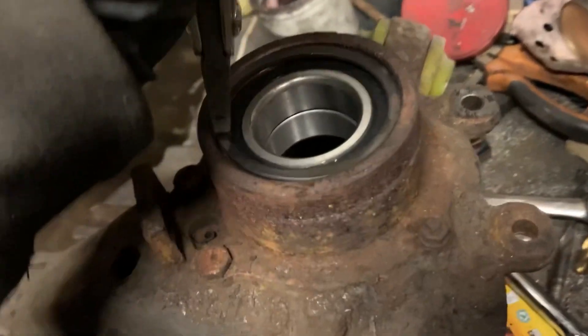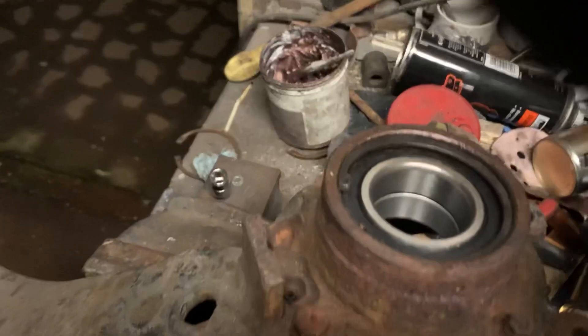Now that's in, we're going to put the circlip in one-handed and see how that goes - almost, look at that - and that is done. Next thing I'm going to do is drill the holes in the disc to match the hub to the 5x114.3 pattern. It's half ten now so I'm going to go have a shower and get some sleep - I'll see you in the morning. I'm going to leave the video there and come back for tomorrow's video where I'll be doing the drilling of the hubs, and also fitting my dial-in toe correction brackets for the trailing arm.